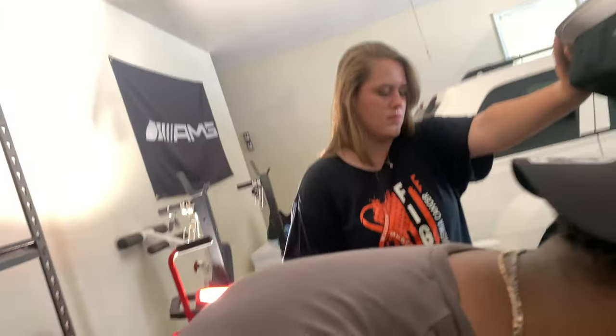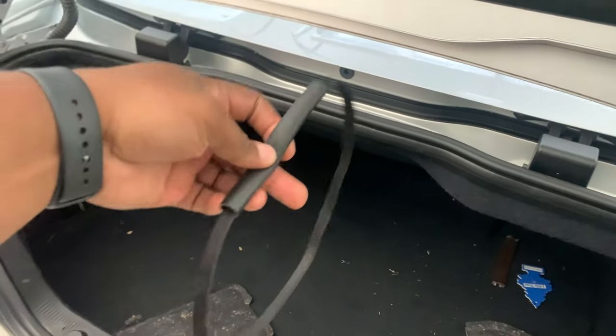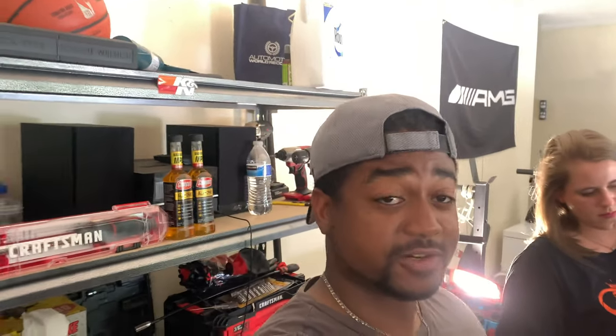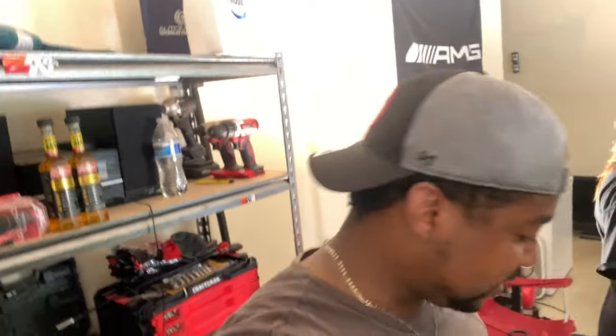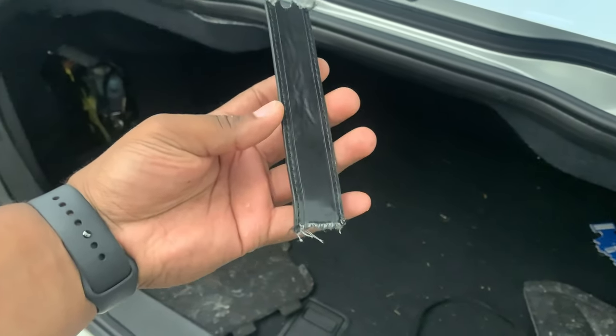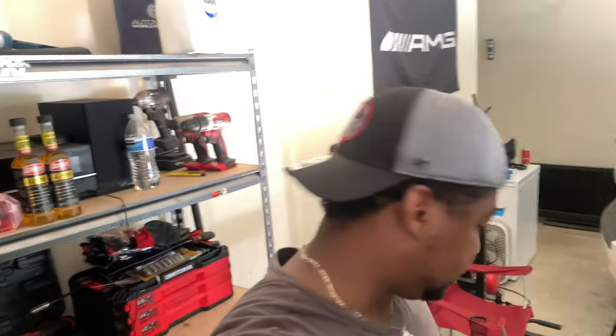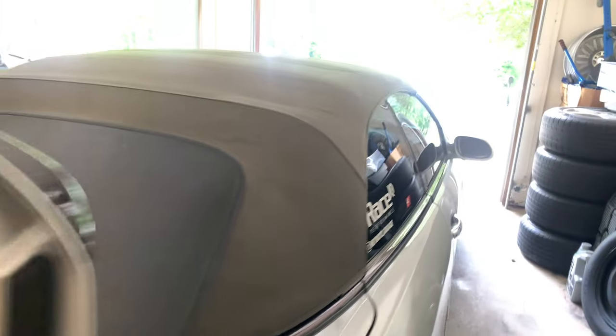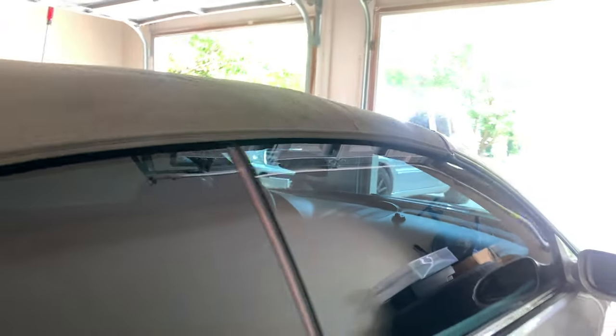The first thing you need is actually in my trunk — there are two things you'll need. The first one comes equipped with your CLK from the factory. This was included in your car so that when your top isn't working and it starts raining, you can use it to bring the top back up. If you don't have that, you can use an old belt, but you need something longer. You'll also need a size 6 allen wrench to undo the top.